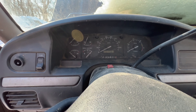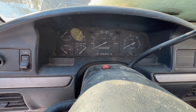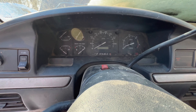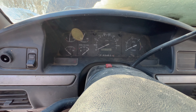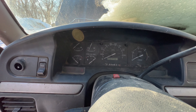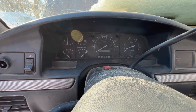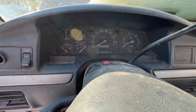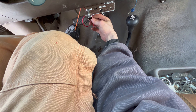Got more voltage now, okay, it goes down. We'll just try it. Okay wait — yeah, see, the glow plug isn't working. The plugs aren't working so we've got an issue somewhere — a ground issue maybe. I can smell it trying to fire but we've got no glow plugs.